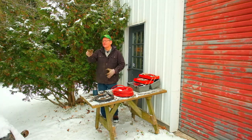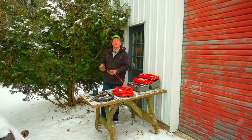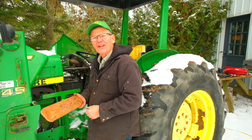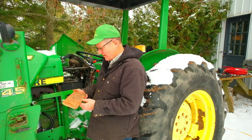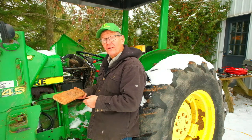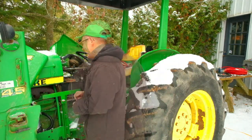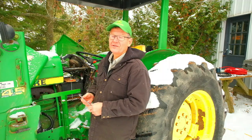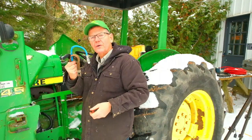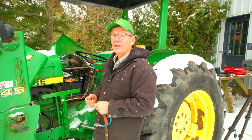The first thing I'm going to do is pull off the old batteries, take the old cables out, and before I make these cables I'm going to put the battery in just to see how it sits, because I want to keep these as short as reasonably possible. I love to write little notes when I'm doing work. Here, on the 8th of December three years ago, I said 'warm and no snow,' and I named my wife, our children and grandchildren — actually only one granddaughter then — and I said 'I am blessed.' I really am. For safety's sake I'm going to take off the ground connections first. Our two ground straps are off. Makes it a lot nicer to work on the positive side — in case a wrench happens to hit something we don't want it to hit, we don't have to worry about any sparks because we don't have a return circuit now.